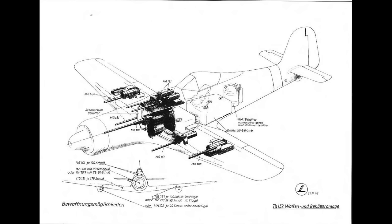I actually talked to an expert on nitrous oxide from a vendor that makes those systems, and he said absolutely no problem, just don't spray fuel through it, which makes a lot of sense. Extra fuel is added to support the nitrous oxide in a metered amount later on downstream. In the case of the TA-152H1, there are at least two stages of nitrous oxide. It's conceivable that maybe there were three stages. Specifically, Wikipedia references three stages of nitrous, but I don't know what plane they're saying that was used on.